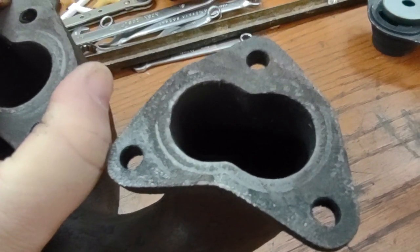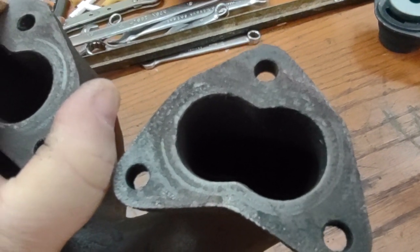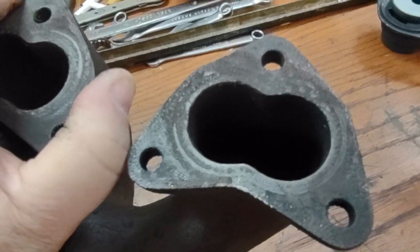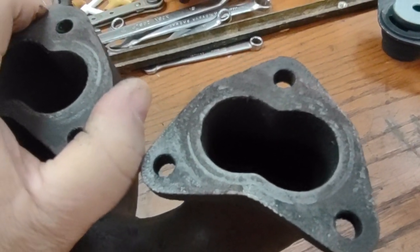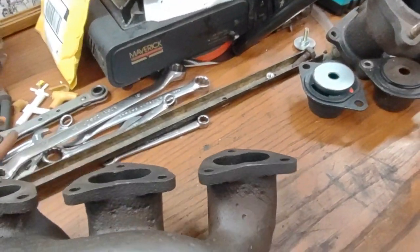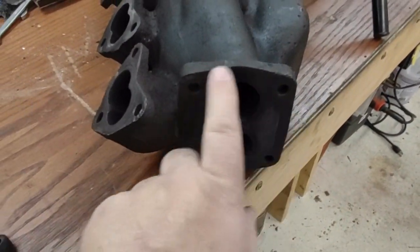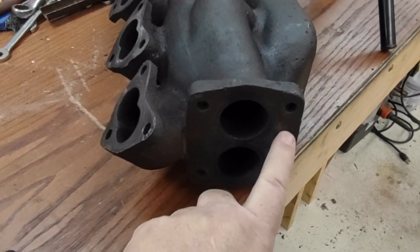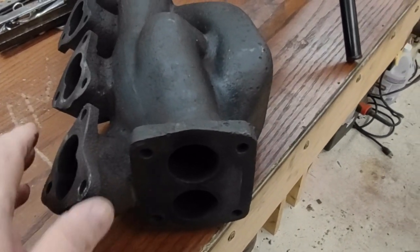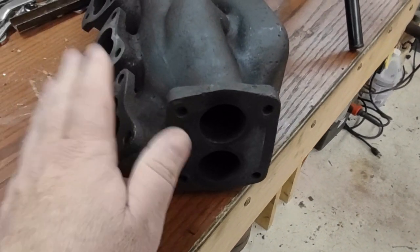There's a lot of corrosion, lots of corrosion. I was cleaning the surface off, and that's why we had a leak. The corrosion was bad enough that the gasket could not hold any longer. So that's why that happened. Also, a problem I was having on this end is that it is no longer straight and true, so that mating surface doesn't work. The other part, where the adapter goes on, is not true either, so both of those things have to be milled if we want to use this.